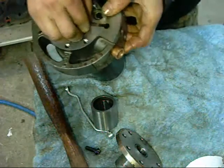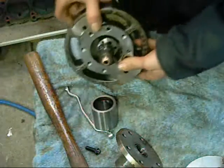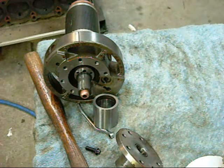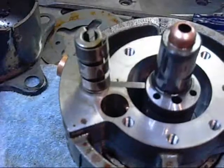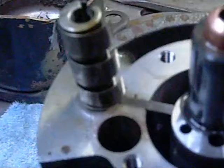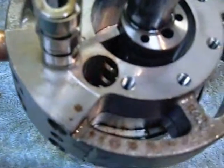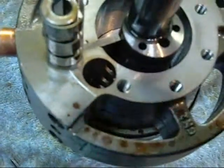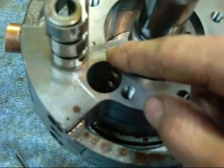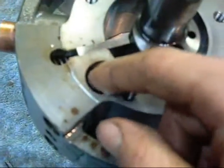I can't get the seal out — undoing the springs. This here is the discharge valve assembly, three little reeds and three ports inside the housing. As the rotor comes around clockwise, it squeezes the gas up against this seal and forces it out through these little valves and through the discharge passage.